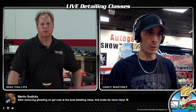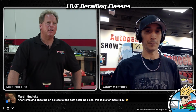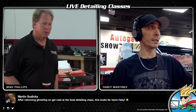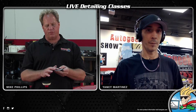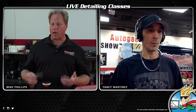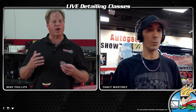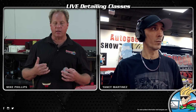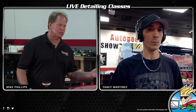Martin, after removing ghosting on gel coat at the boat detailing class, this looks far more risky. Well, it just depends. I've been doing this for years, so I feel comfortable. But then again, gel coat is a different beast. It's thicker. Car paint is thinner, so I guess it could be a little bit more risky. If you ever are around a piece of Trizact 3000, it feels like a piece of paper. It's not like sanding with 1,000 grit or 1,500 or even 2,000. It's very, very refined. I'm using a very safe tool. I only turn the speed up just enough to maintain pad rotation. I had an interface pad on there to reduce the aggressiveness also. So it was a very safe process, and the results are just phenomenal.